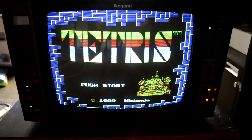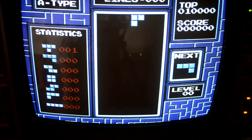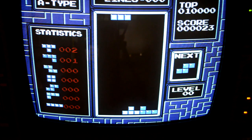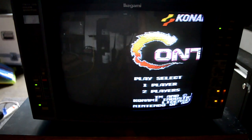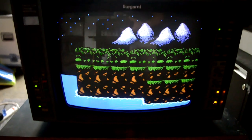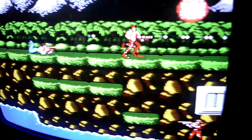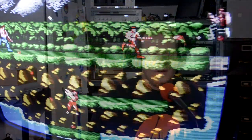This is something most people can do to any CRT — get inside the back of it, clean out the dust, and make a couple of adjustments. Even if you don't have the capability to do a capacitor replacement, your caps could still be good enough to get it looking really nice. Once you get into these older monitors, it's always worth considering whether you really want to invest all the extra time and money into a capacitor replacement or just clean and adjust it. Either way, you can make that CRT last long and look great when using it, especially for 240p. I'm Steve — thanks for watching everybody, I'll see you next time with some more retro content.